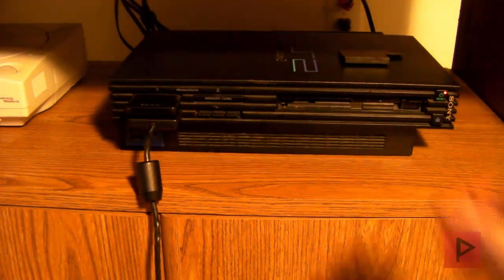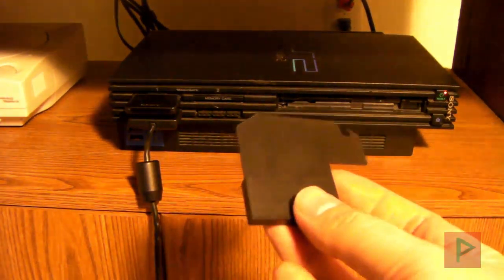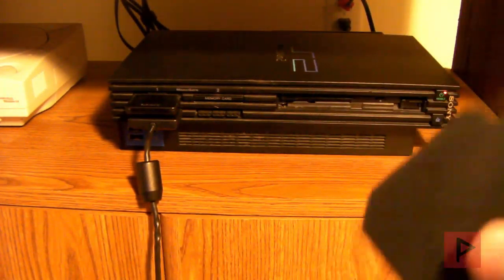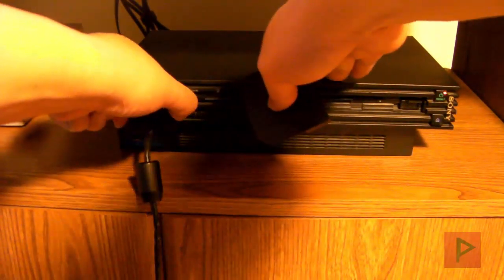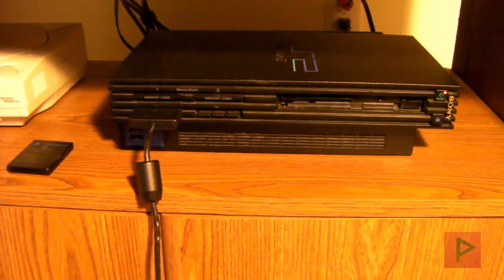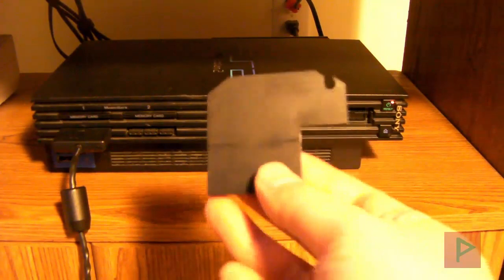See the more info description if you're curious about how that works. Next thing, I have a FAT PS2, and it also comes with this slide tool as well. So this portion of the video, let me show you how the slide tool works, and then I'll show you how Swap Magic works in action. One thing I'm going to do is remove my memory card because that has FMCB installed, and I don't want that to automatically move to FMCB when I do the Swap Magic trick. But how does the Swap Magic slide tool card work?